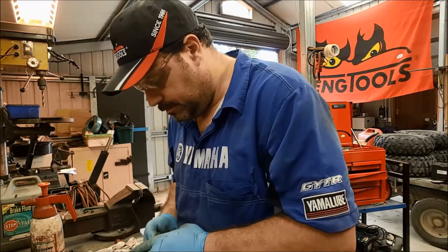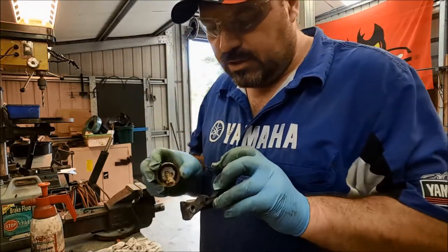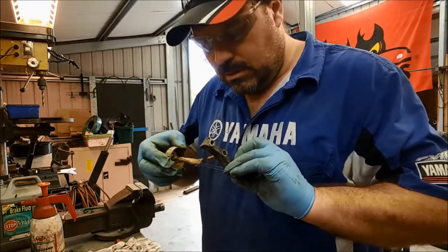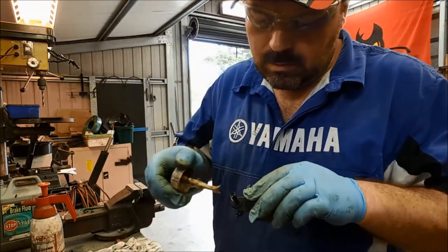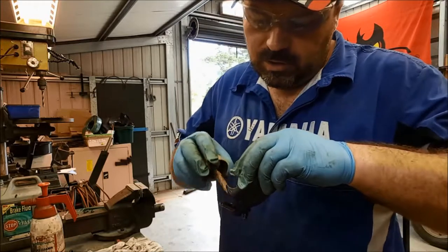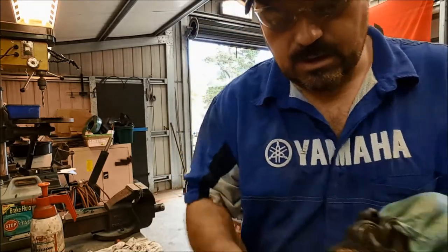Right, time for some grease. Now, on these sliders, remember calipers can get very, very hot. It's important that we use some heat-resistant grease. In this case, I call it copper slip because I'm English. Copper paste if you're New Zealandish. That's one. And putting this copper paste on there, this copper slip, is going to help those sliders to stay sliders for a long time yet.